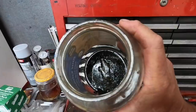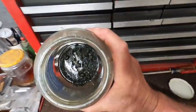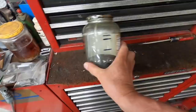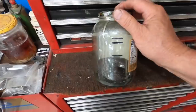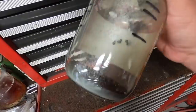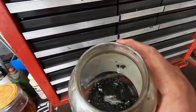That little bit of paint is all waste - it would have probably painted the door jam on the car if I'd had it ready and masked when I painted the rear quarters. That's why you never put this paint back in your gallon or anything - you always discard your mixed paint. When I mixed it I used this - eight parts paint, three parts reducer, one part hardener into this jar. Look at the metallic where I scratched it with the screwdriver - you can definitely see the subtle metallic. The blacks and all the colors that make the green are in there. The mixing formula is right on the can.